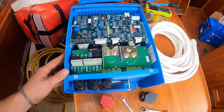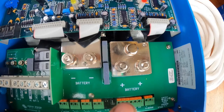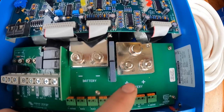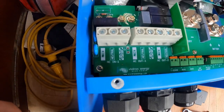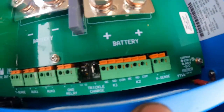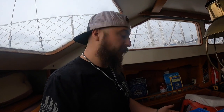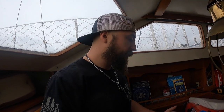Take the four screws out and you get inside here. It might look a little scary at first glance, but you look in here and you've got battery positive and negative - we'll just be using one lug of each. And then you come in here and here's your AC circuits: you've got AC in, AC out one, AC out two, and then your sensor hookups here. For me, that's pretty basic. If I had to get into someone else's unit not knowing how to do this, you can pull the cover and you have a good idea of where the power is going in and where the power is coming out. These things wire up pretty simple.